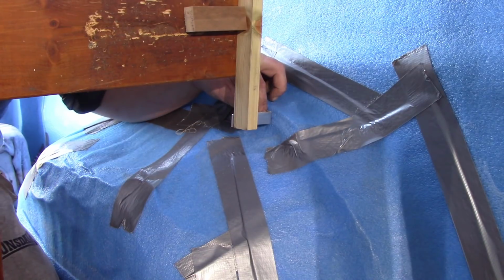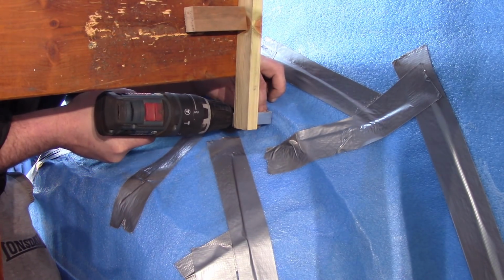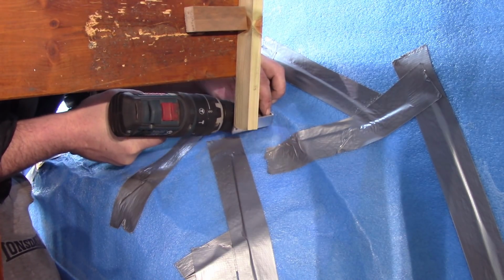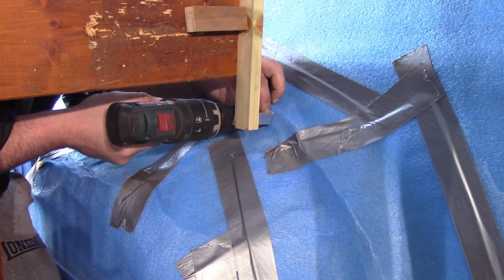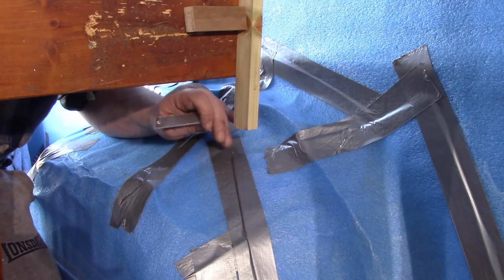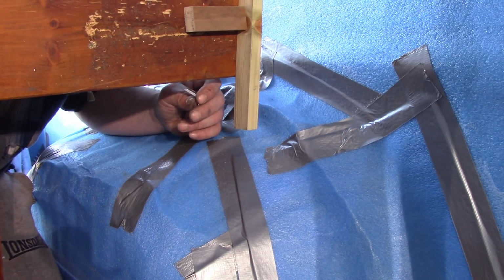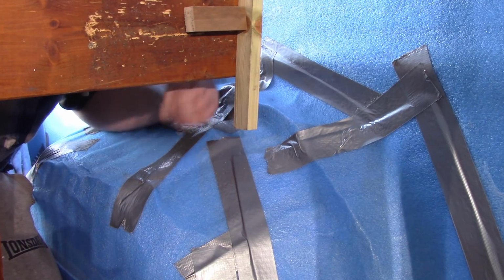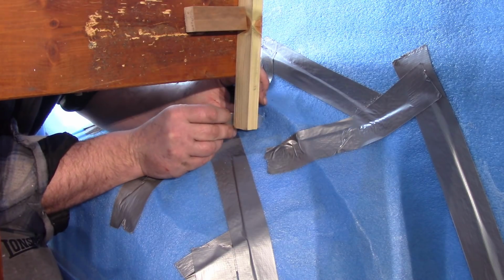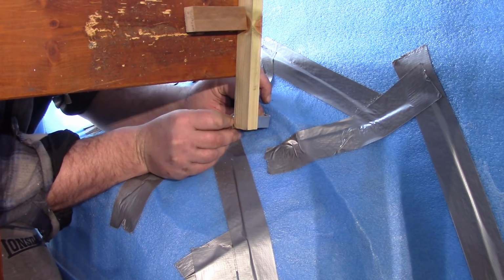My standard batten to floor bracket wouldn't work above the wheel arch, so I made another couple of brackets up, because the last thing I want to do is drill through the arch. It's good and sturdy, but it's going to get spray, and I don't want road spray travelling up the screw and potentially getting into the insulation.